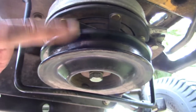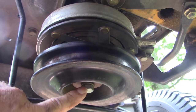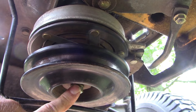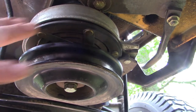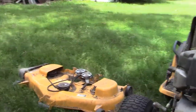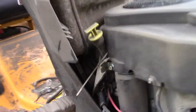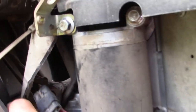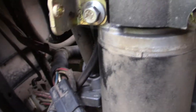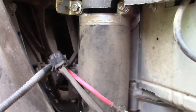To do that, we've got to drop the electric PTO, which is this guy here, taking off this bolt. I've got a small impact gun that should take that down. Removing this PTO is the first step. I don't want to drop it until I unplug the wiring harness, which is up here. The wiring harness for the PTO comes through here — this wire right here.